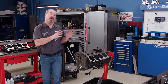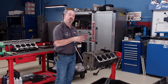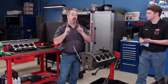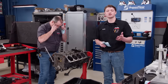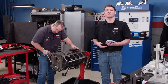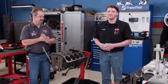This is as far as we are tearing this engine apart. It looks good, everything ran great, and we have a very solid foundation with our 410 cubic inch forged rotating assembly. We'll get rid of the stock parts and put them in storage in case we want them later. Before we put the camshaft and new induction package on, we're going to paint the engine a very nice color. We usually don't pick conventional colors, and this time is no different.